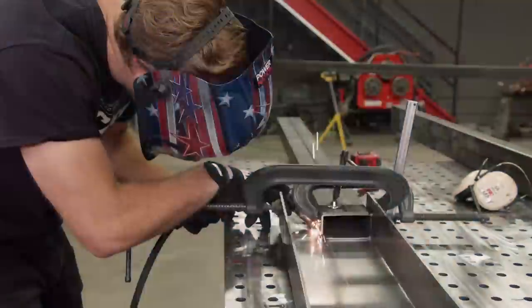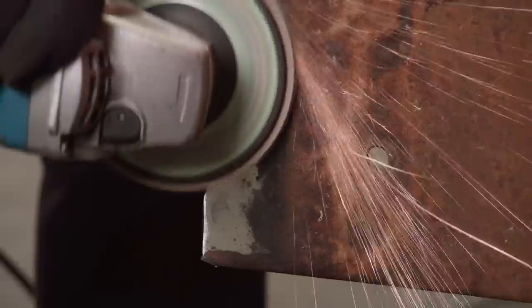It all comes down to this — all the math, the measuring, cutting and welding, just to get some weld gaps right. Not to mention, you already prepped the chassis, so where we're going to weld is going to be nice and strong. We don't have giant holes in the frame rails, so it's going to be a whole lot safer. We just got to pull a quick measurement to make sure the front and back are nice and straight before you weld it in.